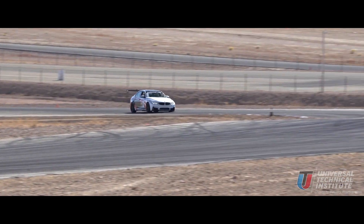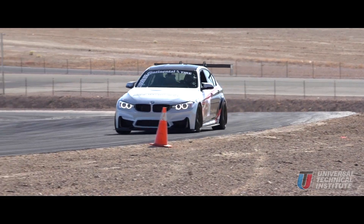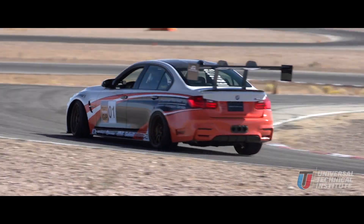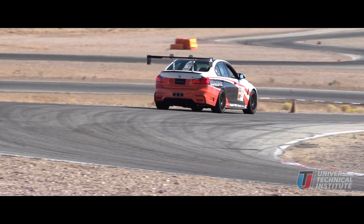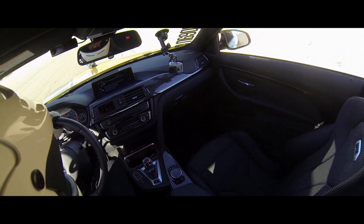Events like the Euro GP place a lot of g-forces on the vehicle as it goes through corners. In a traditional wet sump system, the oil would want to slosh away from the oil pickup — that isn't the case on a dry sump system. Because we store the oil remotely and have a separate scavenging pump, the oil supply will always be at the ready to keep that engine alive and cool regardless of the g-forces. Dry sump oiling systems are usually more costly and complex, but if you're going to be competing at a higher level, you might want to make that investment.